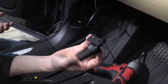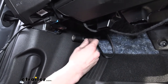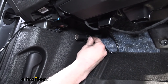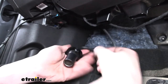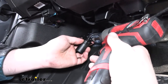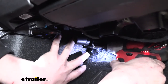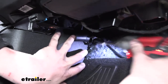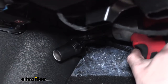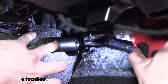The bracket can now be mounted wherever you want — whether down below on the dash. This is an airbag here so avoid that area. We're mounting ours on the panel to the lower left on the driver's side — the same panel where your hood release lever is. You'll receive a couple of self-tappers in your kit. They slide through your bracket and we run them down with a 10mm socket, finding the right angle we want it to be at. We'll have ours at just a slight downward angle so it's a little easier to access.